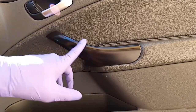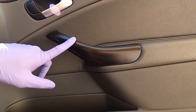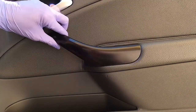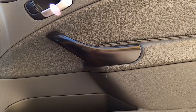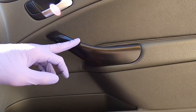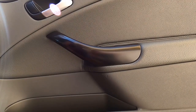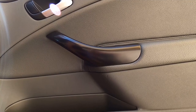I know what you're saying — this looks great, but it looks like cheap plastic and doesn't match the rest of the door. You want the factory look? Simply pull the interior trim piece off using a screwdriver or an interior trim piece removal kit, sand it down or scuff it to rough up the texture, spray rubber coating or Plasti-Dip, do a few coats, let it dry, and pop it back on. You'll have a piece that looks exactly like it did from the factory. The downside is they don't last forever, so you may be doing this exact job again in three to five years depending on how much the car sits in the sun. I may or may not do that — I actually kind of like this clean plastic look, but I'm thinking about doing a Plasti-Dip to return it to factory. Maybe we'll see.